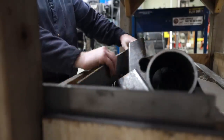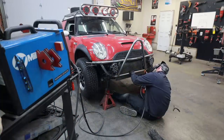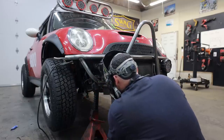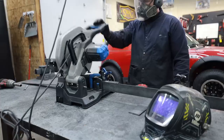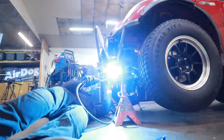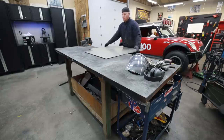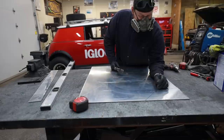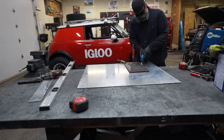This lower protective piece is built out of a combination of 3/16 and quarter-inch steel — I just used scrap from previous projects. For something this important I wouldn't go anything less than 3/16. Quarter-inch is heavy but also heavy duty, and I have a lot of confidence it could take a pretty decent rock impact without bending into anything important. For the skid plate I'm going to use aluminum because I don't want to have to paint it and I have it on hand. At 3/16 thickness it's a good choice — this isn't a rock crawler, it's essentially a one-wheel-drive vehicle.